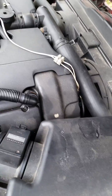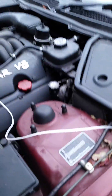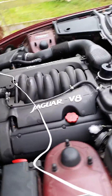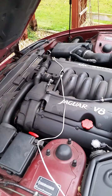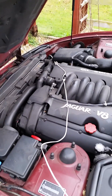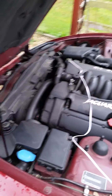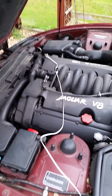OK, so there's the death rattle from the engine. Now I'm going to come around here and I'm just going to give it a burst of VVT. There — and it immediately clears the knocking from the engine. When you operate that VVT solenoid, that causes oil to be squirted into the VVT hub. And what I think is happening on this engine is that that squirt of oil is enough to quiet down the VVT for a while.